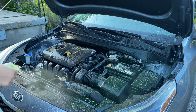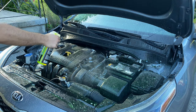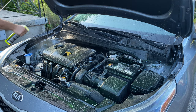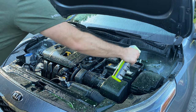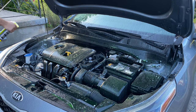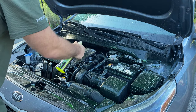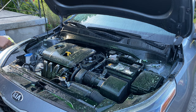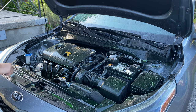Now there's a few methods to doing this. I've seen people spray it directly onto the engine bay with no water rinse before. I'm going to be spraying it over the water and I won't let it dwell for too long — however, to each their own. I've seen people also dilute this particular product, but I'm just going to use it as it is out of the bottle. I sprayed pretty liberally around the engine bay and made sure not to spray directly onto the alternator — that's the one thing I didn't want to touch.